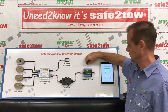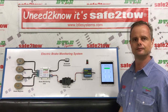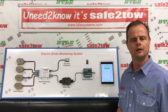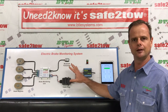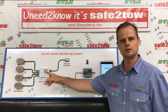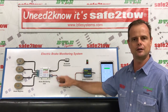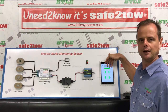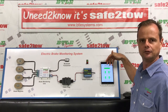Such as wet roads, dry roads, or city travel. Another benefit of the system is that it provides an easy way to test your breakaway system. To test your breakaway system normally you pull your breakaway key and then have to jack up a wheel and try to spin it. But with the Safe to Tow system installed, testing is easy - you pull your breakaway key, look at your mobile device, and you should see all bar graphs reading maximum. You can then also load test the breakaway battery by ensuring the brake magnets stay energized for a minimum of 15 minutes.